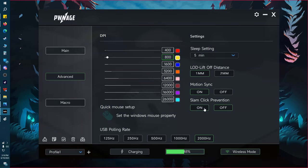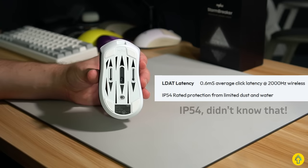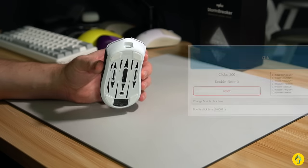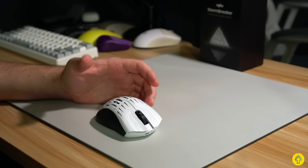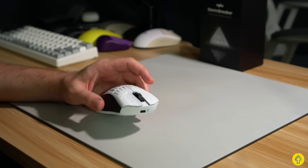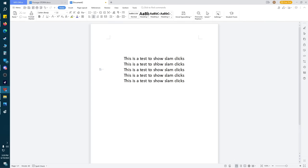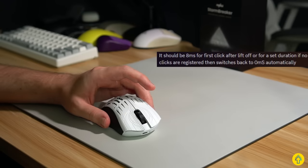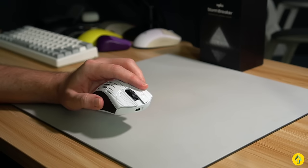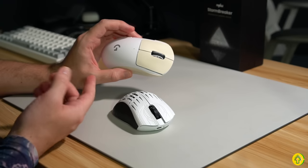You have all the settings you would need, except one — you cannot change the debounce time. Luckily for performance enthusiasts, I did confirm with Pwnage that the debounce is set to 0 milliseconds by default so they can achieve their advertised average 0.6 millisecond click latency. After many hours of use in aim trainers and in game, I followed up with double-click tests of over 300 clicks on each switch and nothing came up. There is a setting for slam click prevention, so yes, this mouse can register clicks on slam — something like this is going to register. If you enable slam click prevention, it adds an 8-millisecond buffer on liftoff for that first click, or it will reset to 0 milliseconds depending on the time between the lift detection and the click itself.